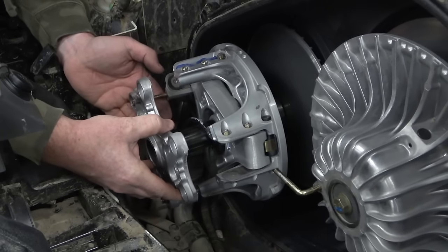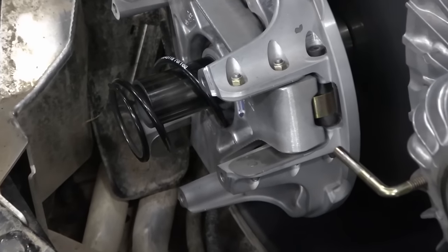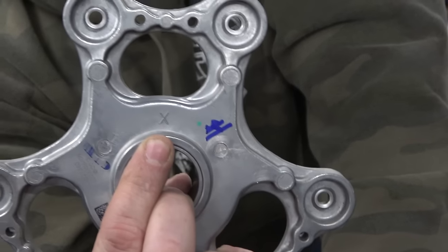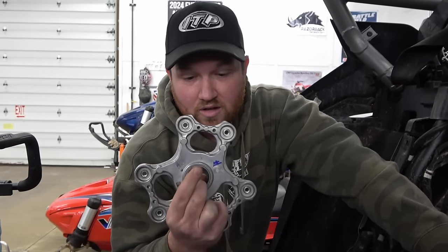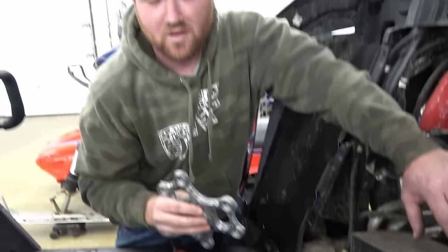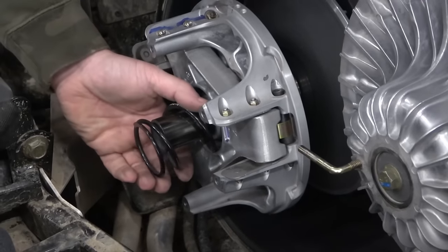Mike held it with his hands before taking the last two bolts all the way out, and he was able to hold it with just his thumb. Now, this is very important: when you pull these apart on any clutch, at least any heavy manufacturer clutch, you'll see these X marks — there's one here and one on the spider. It's very important you line these back up. Basically, from the factory when they machine these clutches, this is where everything takes place in its original position, so they make the X's as a balancing reference — the machining surfaces need to match up correctly again. It's balanced as a unit, so put it back together the same way. You probably won't have a failure if you don't, but just do it correctly and put your mind at ease.